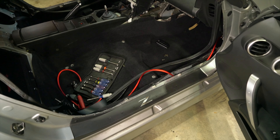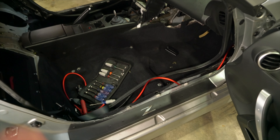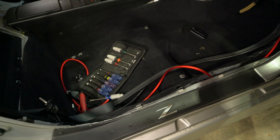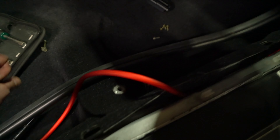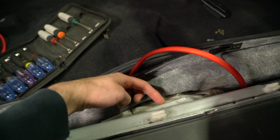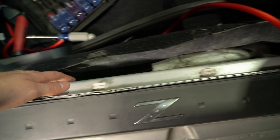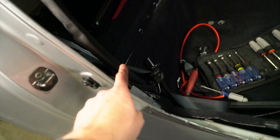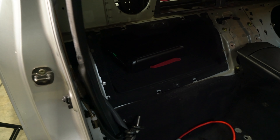Generally speaking, when you're doing car stereo you want to keep the power wire separate from the speaker wires just to avoid any sort of noise in the audio. So I'm going to be running this down the passenger side of the car completely by itself. I'm going to try to utilize a factory wire retainer that doesn't have any wires in it — it runs all the way back along here — so I'm going to try to tuck everything through there, and then we have our amp back in this compartment.